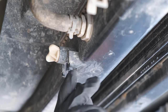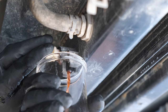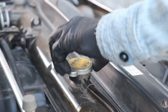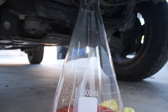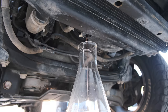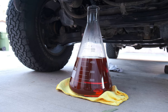First I'm draining the radiator itself — this is the easiest one to get to. You don't need to use any sort of tubing here; it's actually easier to just directly drain it. Removing the radiator cap will help speed things up a little bit. I'm just using this giant Erlenmeyer flask because I was really curious how much fluid I would actually be able to drain out.